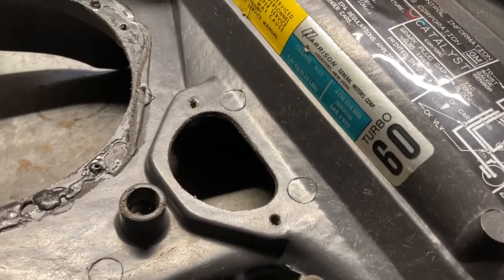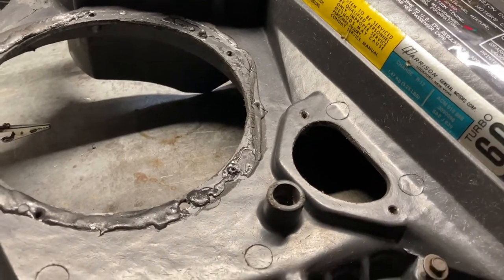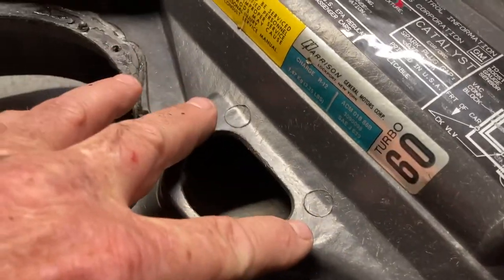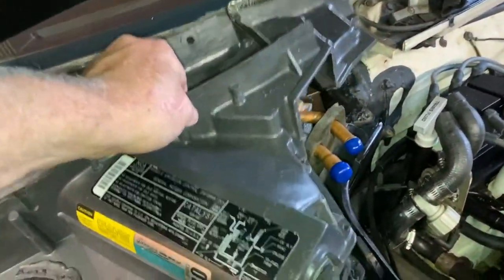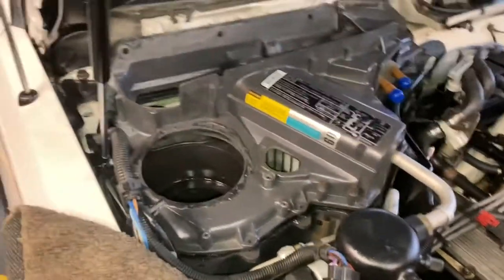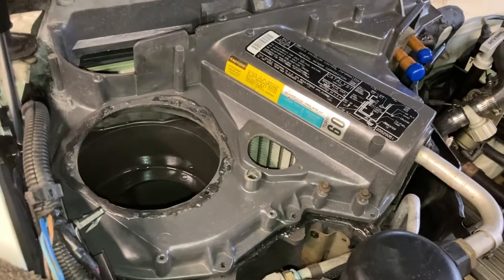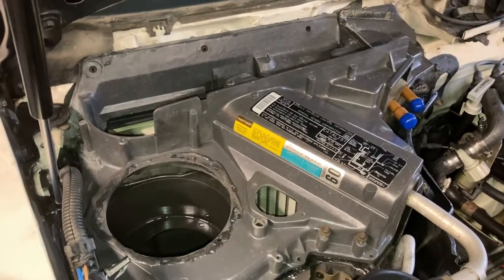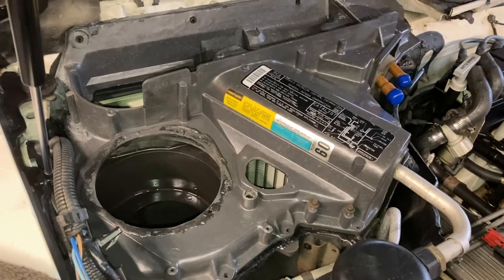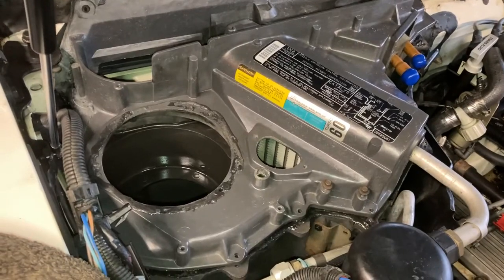Nothing particularly hard, just pay attention with that there. You don't really disturb anything. A couple of sevens hold that. A couple more sevens hold this. So if everything's all lined up right and you put this in a certain way, look at this. I mean, it just falls right into place. So that is, in fact, the case here. And let's now get it cinched down and reverse the removal process, probably starting with those quarter-inch screws and watching very carefully that all the lips are sealed.